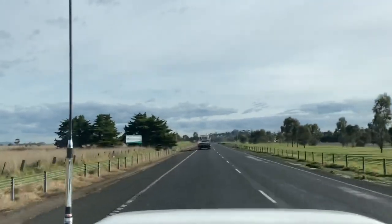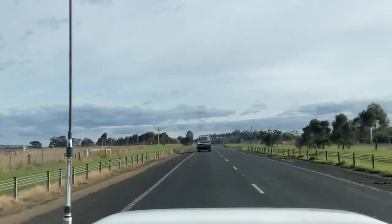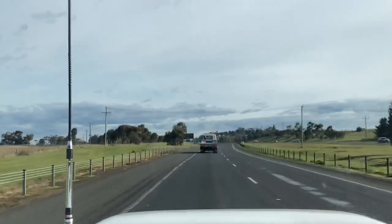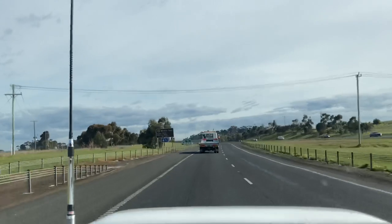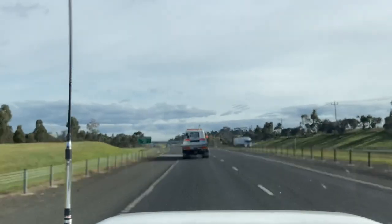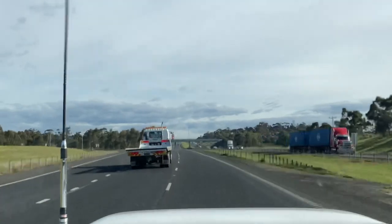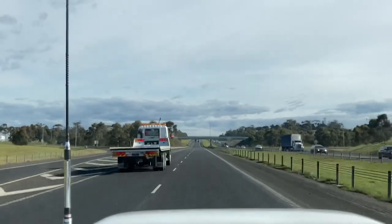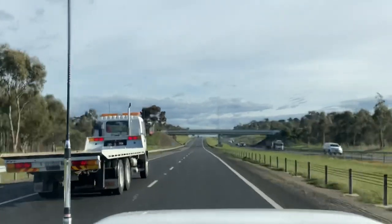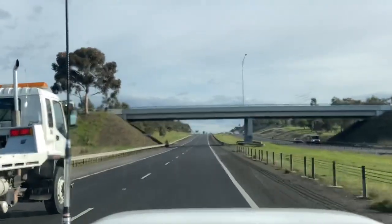Right now with the four-speed auto, even though this Hilux is lighter and more aerodynamic than the Prado, because of the software settings and the lack of torque from the engine — they are detuned compared to the Prado — it's very difficult to maintain torque converter lock. I can see we've got a bit of vibration going on with the camera; that's obviously just vibration through the vehicle and the roads.